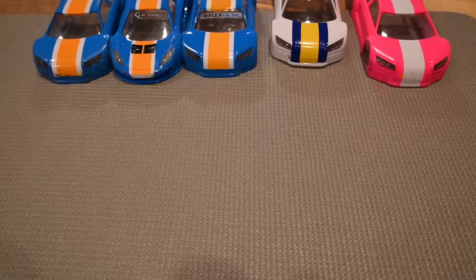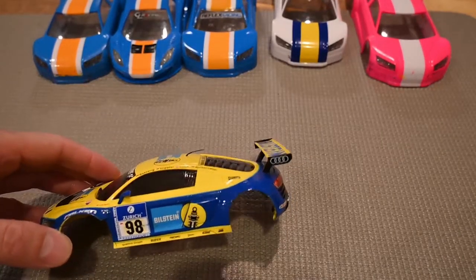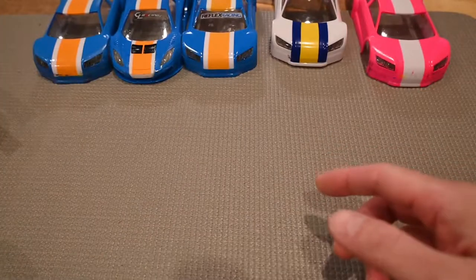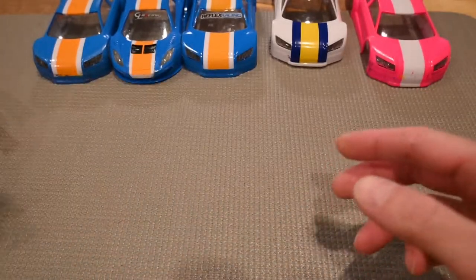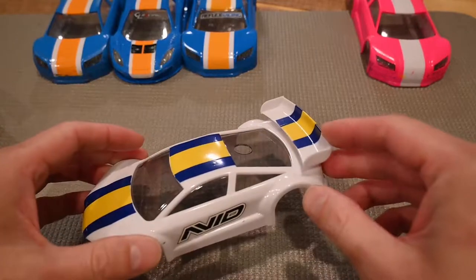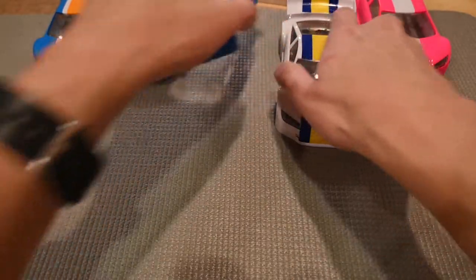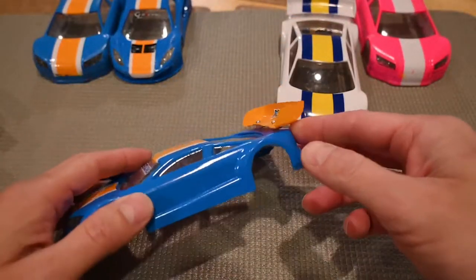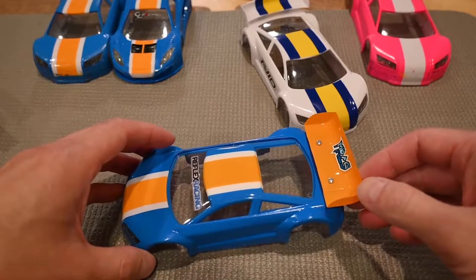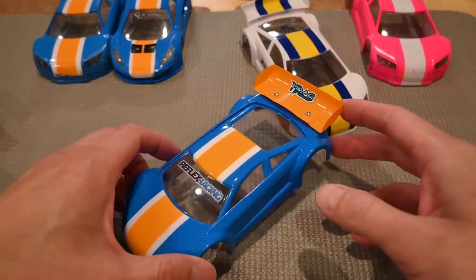One of the first things you want to do is look at the rear wing. The stock rear wing on the car looks pretty and adds some weight, but is not very aerodynamic and doesn't provide much downforce. The Jomarima wing is fairly aerodynamic, but for best performance you want an aftermarket Lexan wing, which is much bigger and provides more downforce, stability, and directional stability at high speed.